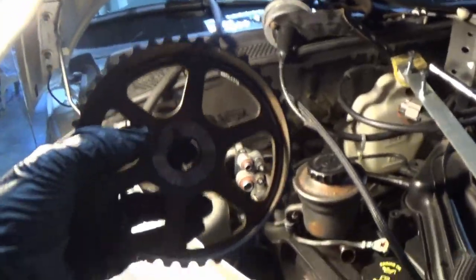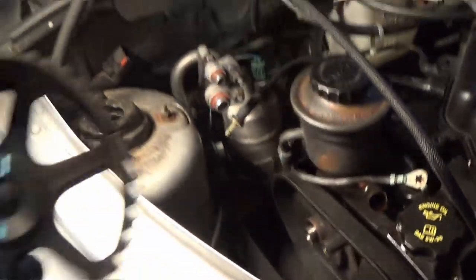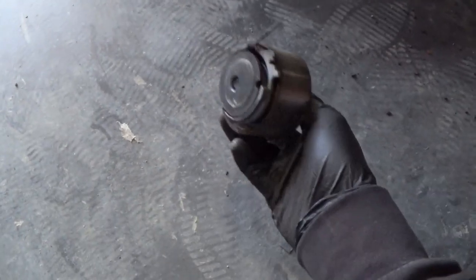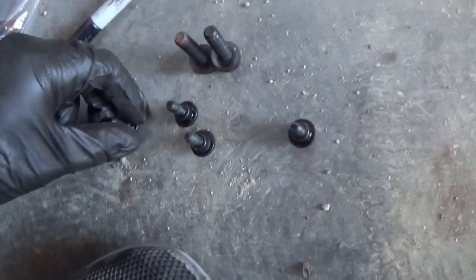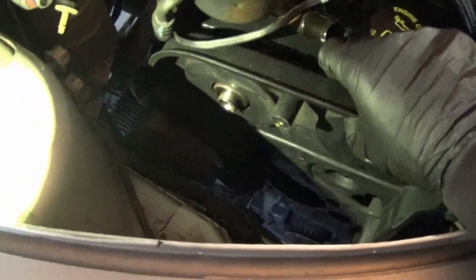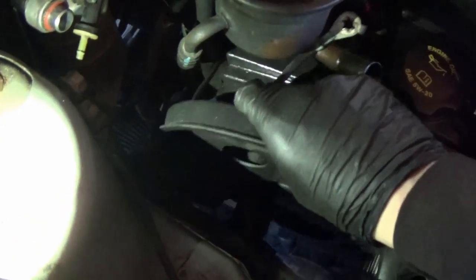And yeah, our cam gears are not the issue. I don't need to get new gears. I need to fix our pin, and we might be able to simply fix the pin. I'm not sure, but we're going to find out. Hopefully, we don't have to replace a whole camshaft. Off camera, I just went ahead and pulled off our idler pulley right here and our tensioner pulley as well. I also pulled these four little bolts. I think they're 8 millimeters, and then these two little 13s on the bottom of our back timing cover thing. And now it should just come right on out of here.